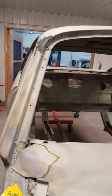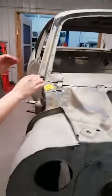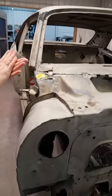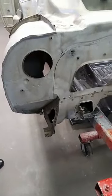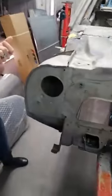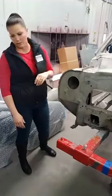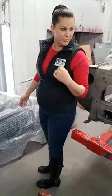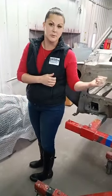There are a lot of lap welds and some brazing. Lap welds are when they take the new metal and just put it over or behind the old metal, overlapping one section and welding that seam. We do butt welds and we always weld everything completely so you don't have any areas of weakness. The entire firewall is getting replaced. All of the metal is here — it's going to get door skins. We have both doors but they're both in need of some help, and honestly I haven't even looked at them yet because this is the focus at the moment.